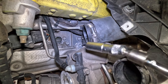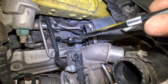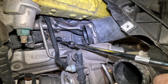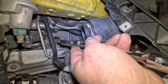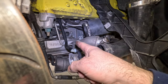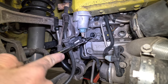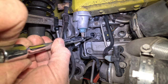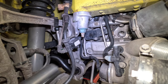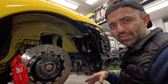This is a walk in the park but you have to pay attention to the fact that the spark plug is not straight — it's at an angle, so be mindful of that. If you've got wobble extensions they'll account for the angle. Put some grease on the tip. Before putting back the coil pack, disconnect the first one, then with the coil pack back in make sure it clicks. Don't forget the middle one — and this side is done.